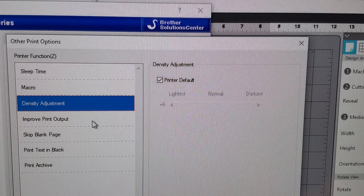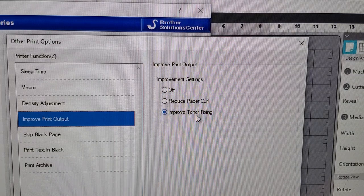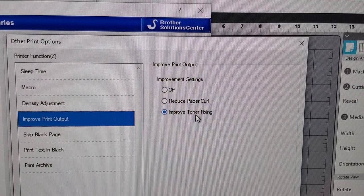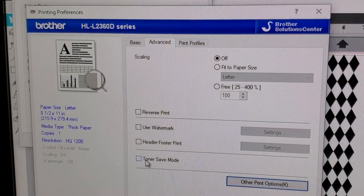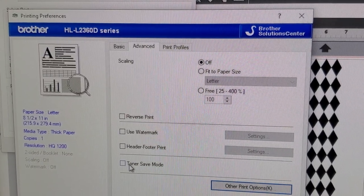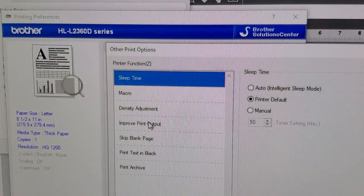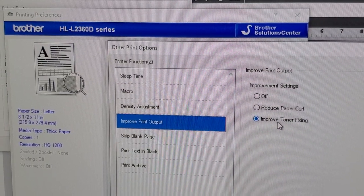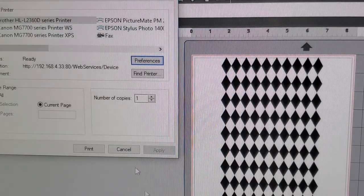So I leave mine to printer default. Then I'm going to go to Improve Printer Output and I want Improve Toner Fixation. Now there is a setting — Improve Toner Fixation. What that's going to do is it's going to heat up our toner a little bit hotter and longer so that it sticks to the paper quicker. And then hit Okay. Now there is a setting in here that says Toner Save Mode. Do not have that clicked. What that is going to do is under-toner your image and you will not get enough toner for the foil to stick to. So if you have Toner Save Mode clicked on yours, unclick it. Go into Other Print Options, Improve Print Output, and click Improve Toner Fixation. That will help dry the toner a little quicker. Hit Okay, hit Okay, and then we are going to print.